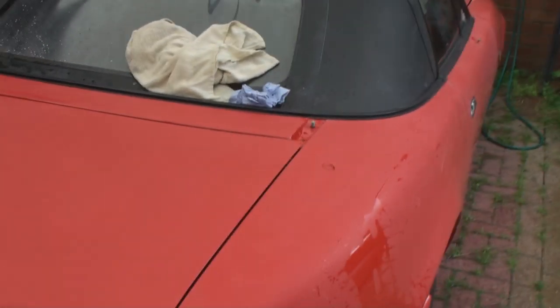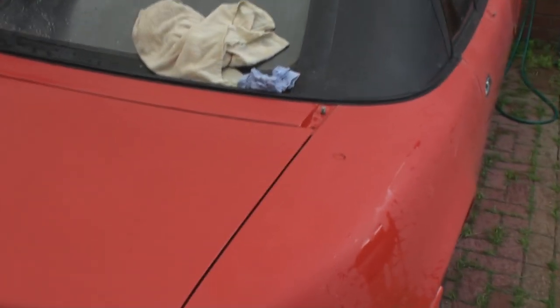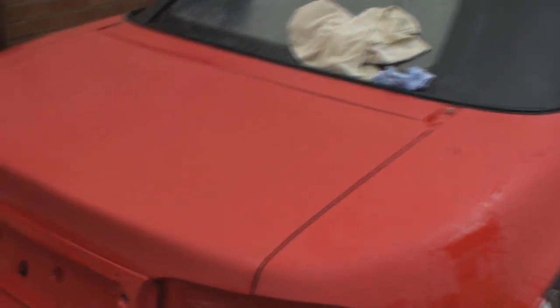The only part which you normally would do colour sanding, wet sanding on the top coat, is the tops of the wings, for example, like here, the boot lids, the tops of the doors, the bonnet, obviously. Those are the sort of areas that you would basically do, unless you were creating a show car where you would obviously do the whole car. But this will show that we've got an actual lovely finish now, and this is ready now for buffing.